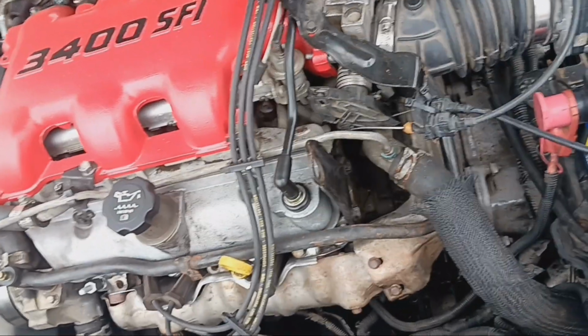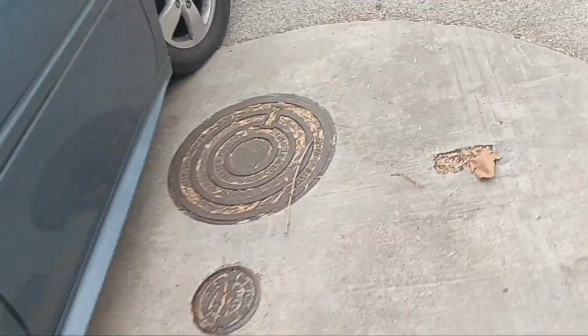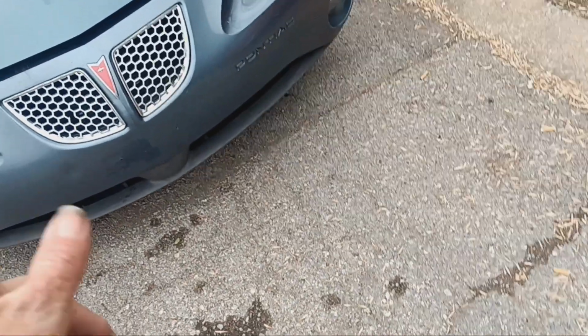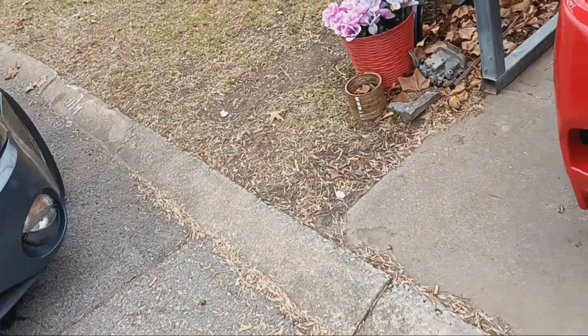So right now we have five vehicles and every one of them is broke down. This one's going to need a harness and some brake work. This one's going to need all new engine gaskets and probably head gaskets and head bolts. And then we ordered a new radiator for it. It should be here sometime in the next 4 or 5 days. So I'm waiting for the radiator for this. Still got to order head gaskets and head bolts. That one, I pretty much have everything I need except for brake fluid. This one needs the fuel pump and the slave. This one needs an engine and a key.